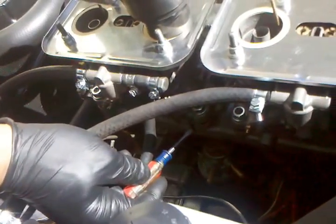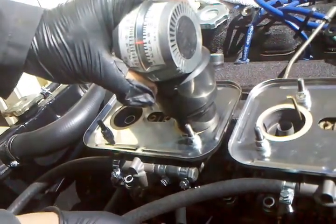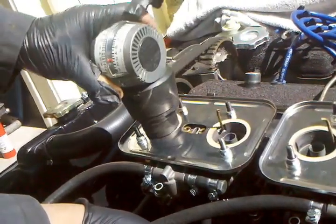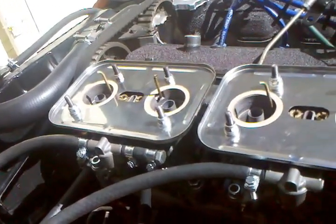The number two barrel? Yes, older number two. You want those to read exactly the same, right? As close as we can get them. It doesn't help when the fan goes on because that can disturb the reading on the synchrometer.